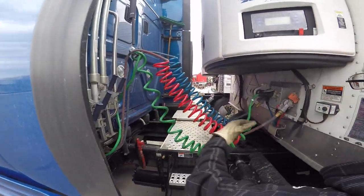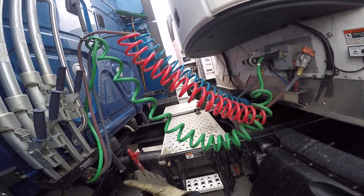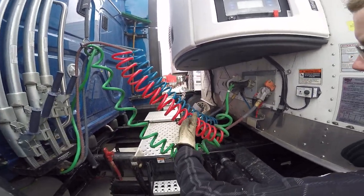All right, my airlines, both truck and trailer, are properly mounted and secured at both ends. Not cracked, bent, or broken. No abrasion, bulges, or cuts. Not leaking.